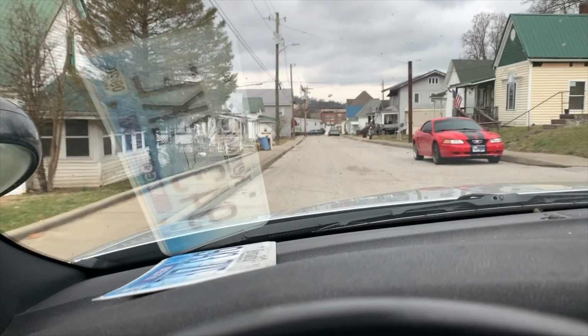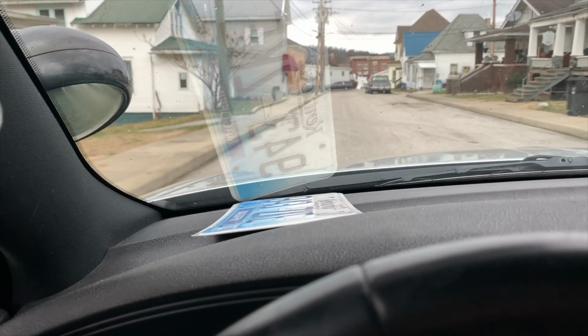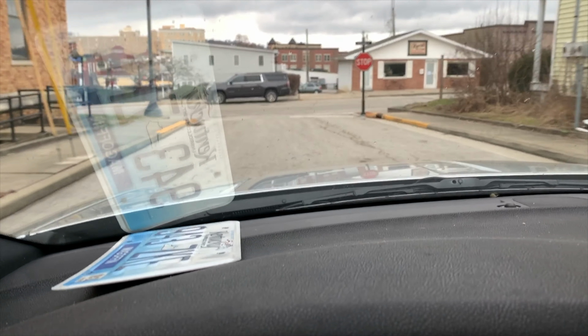Let's try it. So it is driving, but it felt like something made a popping noise when I turned, so I'm imagining one of the knuckles or something is bad. But it's driving straight. I don't hear it now. Oh, you know what it was, I bet? That side that doesn't have that nut in it on the rack and pinion made that noise when I turned.